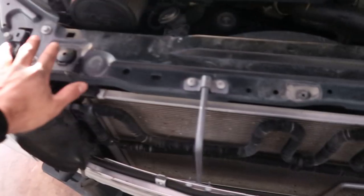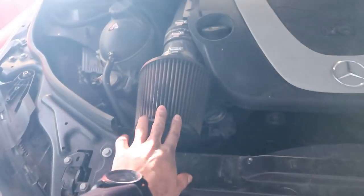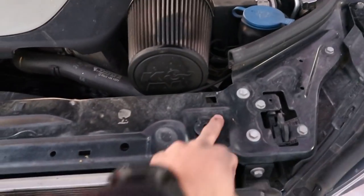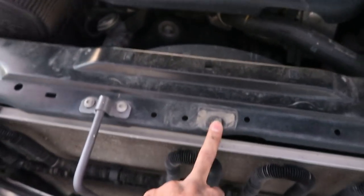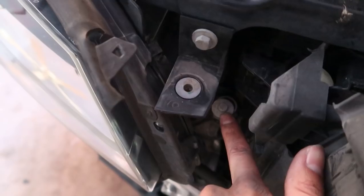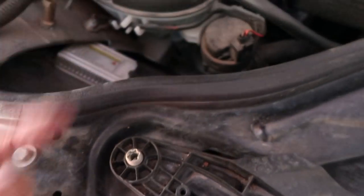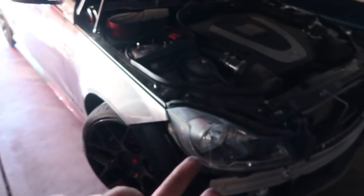For your headlight bolts, there is a plastic cover right here that connects to your air filter area — I already have that off since I have a K&N air filter. There are two clips here — use a flathead to take those off. There is also a bolt here and a bolt here. Once that cover is off, you'll see the grill mount. Then you need to take off this 8mm bolt, another 8mm bolt back here, and there is also a bolt underneath in a little groove that holds the headlight. I believe it's only 3 bolts total holding the whole headlight unit in.